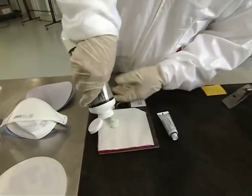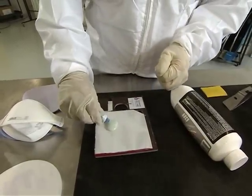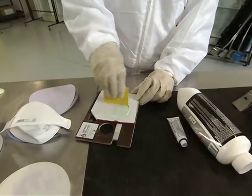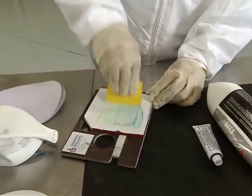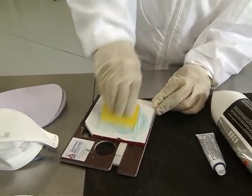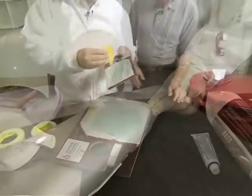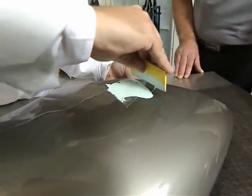I'm going to mix up some two-component polyester glazing putty. It has to be a two-component glazing putty, polyester type. Body fillers typically are too thick for this process. You want something very light and thin — a lighter, medium coat over the top of this. It dries fast, sands easy, and it works very well. Polyester putties vary in color — sometimes pink, sometimes cream, yellow, or in this case blue. The color doesn't matter; it's what the product does for us here that really matters.